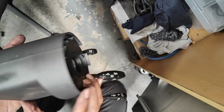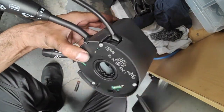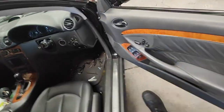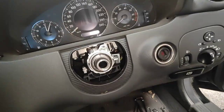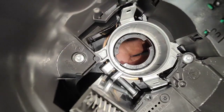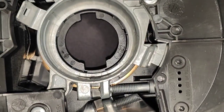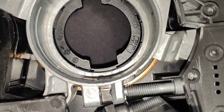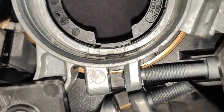So now the screws are still in there inside, as you can see. Now it's going to put this in the car on the right side, onto the actual thing. Make sure when you push it in, you push in slowly, because that part there is going to line up with this part here — otherwise you'll break it. Very important: if you look where the bolt is — see that bolt there — that's what's holding everything into the actual steering column. Make sure that bolt is not protruding into the actual gap there.